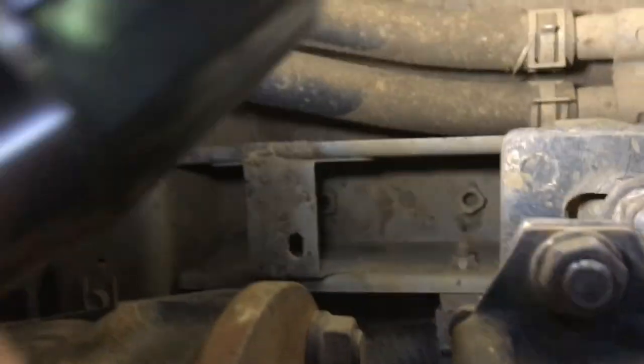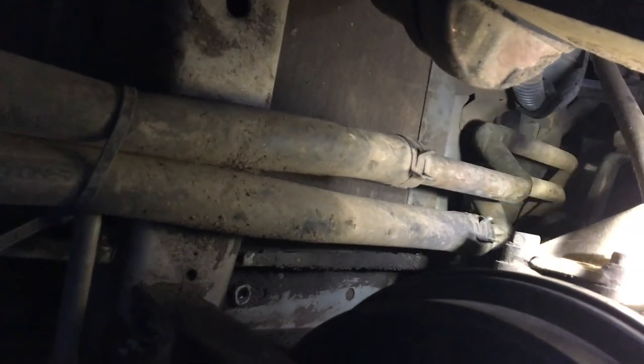And these two hoses here, it's a bit hard to see because they actually connect directly behind this part of the chassis, but anyway, they're actually connected. These two hoses are connected up behind here to these hoses here. So if you follow this along, you can see just there is where the rubber hoses are clamped onto the metal pipes that are going directly to the engine. So the coolant comes from the engine along these hoses up into the heaters. So this is the one near the step at the front of the bus, and the hoses go all the way to the back of the bus where there's another heater in the floor at the back.